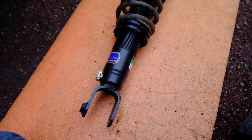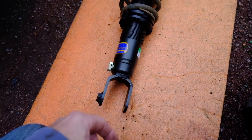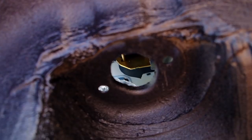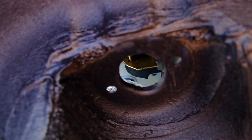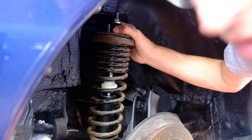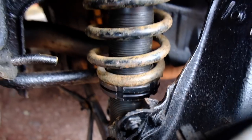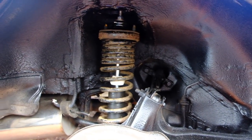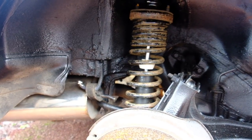This is like a Rover/Honda trailing arm setup. I need to put these little forks over the bush in this link, and these two bolts go through this oval-shaped aperture in the top of the strut tower into the boot, where I can then bolt them up from inside the trunk boot load space. It took 25 turns to adjust it up enough to clear everything and make it all fit. But once it's installed, I can set the ride height correctly and put all four springs to a nice level height on level ground.